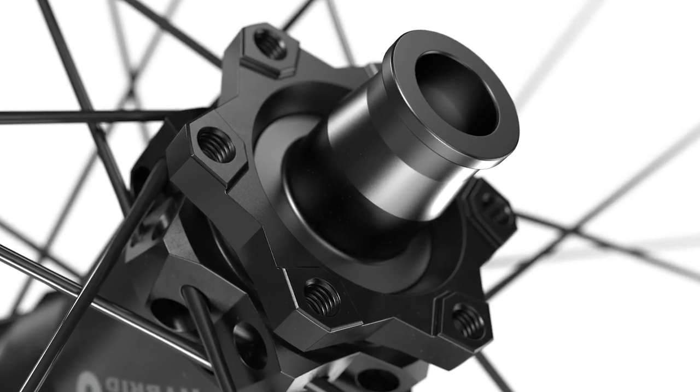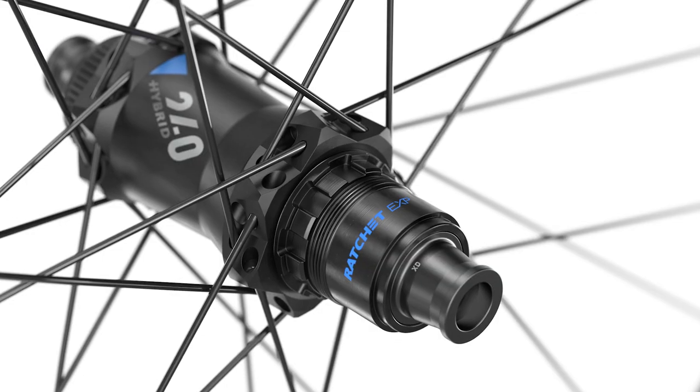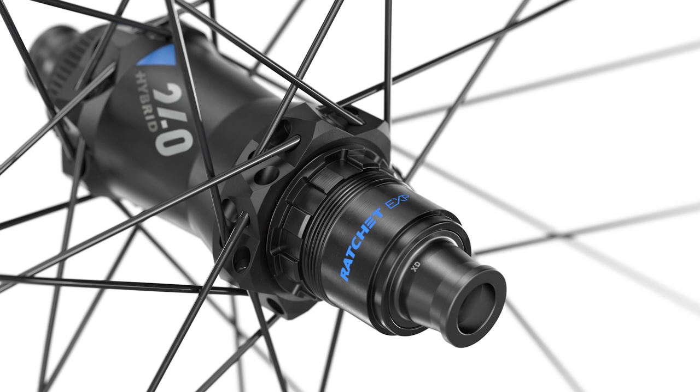Quite a lot of options. To adapt the wheels to different bike types, are there other options like brake mount or freehub options? Yes, the market is developing fast and we are facing more and more standards. All of these wheels are available in centerlock and IS brake mount to cover every disc option in the market. For freehub body, the customer can choose between Shimano Hyperglide, Shimano Microspline, or SRAM XD, and like the previous hybrid wheels, these specific freehub bodies are made of steel. Those hybrid wheels are made and developed to match performance-oriented e-mountain bikes, but we also hear about the so-called light support e-bikes — are the hybrid wheels the right choice for those bikes? You can use these wheels in those bikes, but let's talk about light support e-mountain bikes later in another meeting.